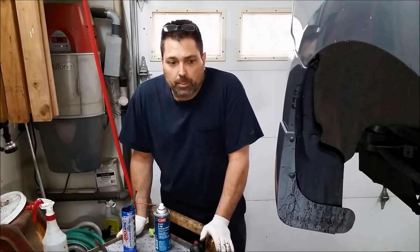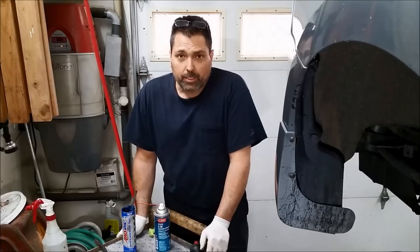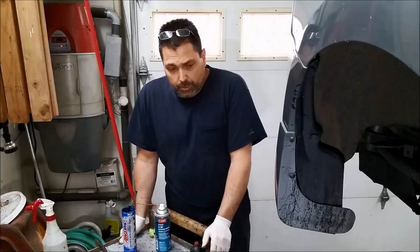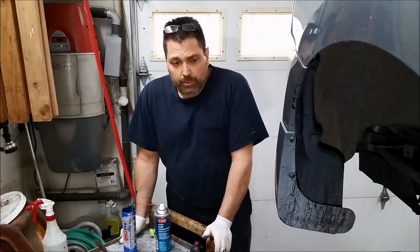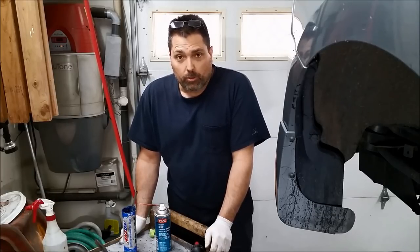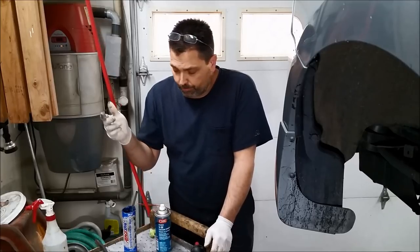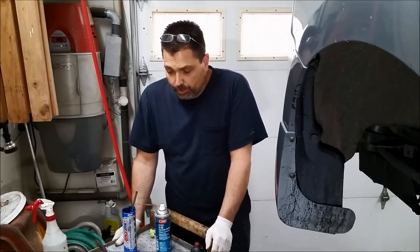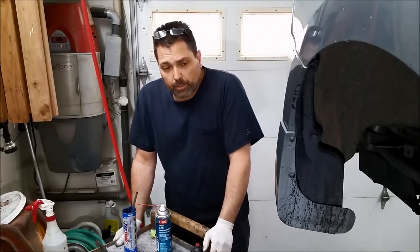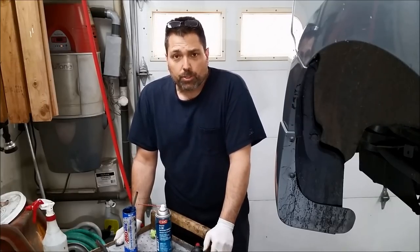That's it in a nutshell — there's not a whole lot more to it. I'm going to put the tire on. I still have to do the other side. We'll road test it — back it up a couple times, hit the brake real hard, and if there's anything left in the adjustment it'll adjust. Keep it clean, make sure everything's lubricated like it's supposed to be. Don't overdo it because you don't want to get grease all over the brake shoes. Use a quality product, hopefully one that doesn't screw up the installation of the pins. That's it — any questions or comments, please leave them below. Like and subscribe, ring the bell.